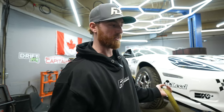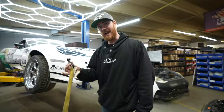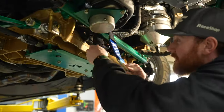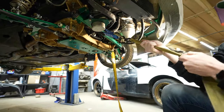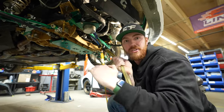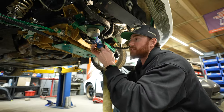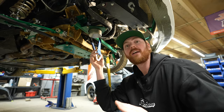I'm going to the suspension components because the suspension will allow us to absorb bumps without loosening the strap. For example, if I hook around a chassis bar and pull down to the ring, I'm compressing the suspension as I tighten. Then as the car goes over bumps, the suspension compresses further and potentially loosens that attachment point. So we don't want to be connecting to the chassis if at all possible.